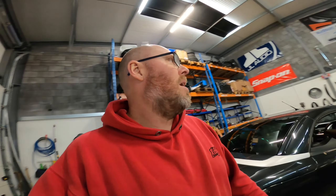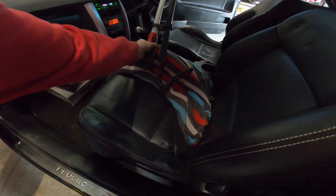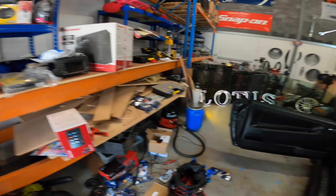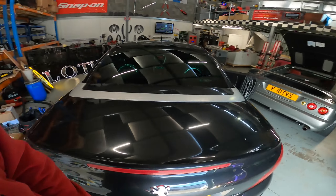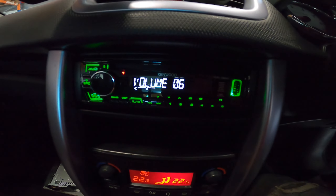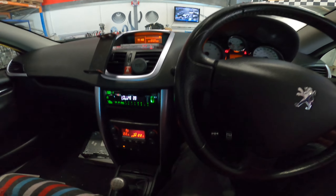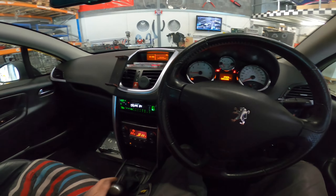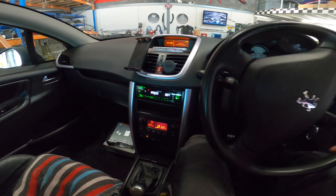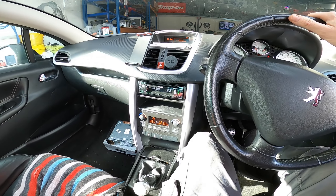The box isn't finished yet, but I'm like a child and I couldn't wait to hear it - and I'll let you know now, it's got some balls. Very, very big balls. That wasn't hard to do - nice and trim. This one's got a Kenwood with steering controls in it. Steering controls working. It had an engine management light on before I touched it - I think the DPF is blocked on it. So we'll go reverse - we've got parking sensor beep. That's a good sign. This is married through the head unit, so obviously if you change the stereo, parking sensors stop working. We need a special lead to keep it going. It's got a nasty drop in acceleration as well - that DPF is not happy.